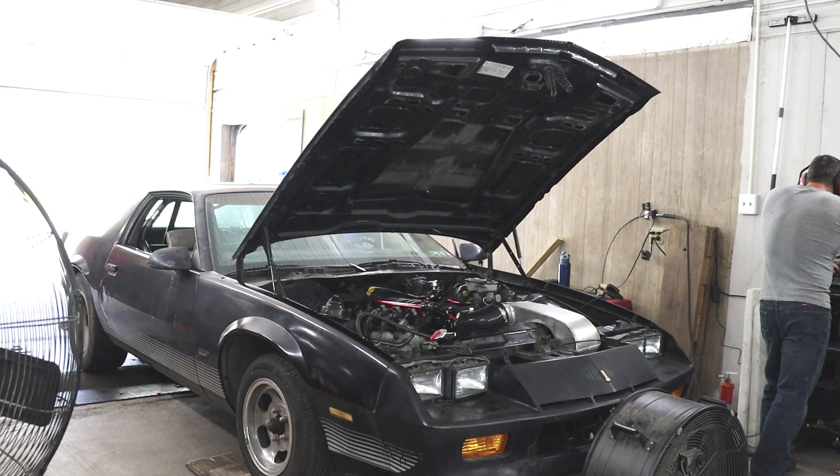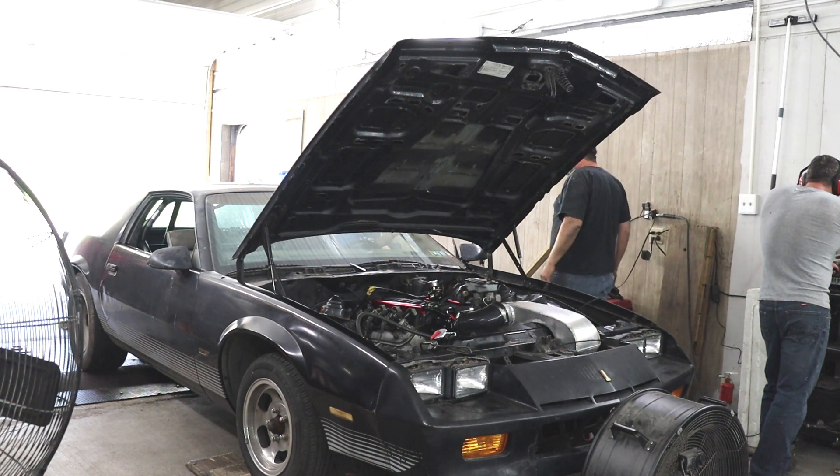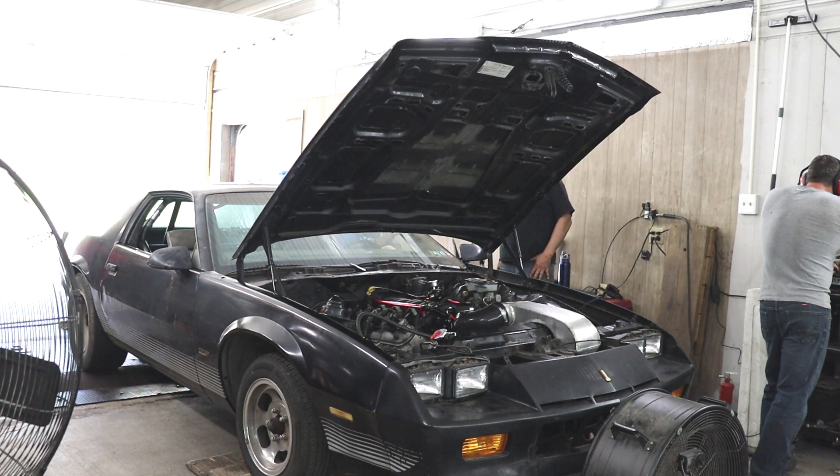As you can see, that was actually worth a little bit of horsepower. Naturally aspirated guys are probably aware that a five horsepower gain is kind of a huge deal. It's not like a boosted engine where you can just turn it up a couple pounds of boost to get to where you want to go. With a naturally aspirated engine, the atmospheric pressure is all the pressure you're going to get, so seeing a five horsepower gain — which was likely due to better distribution of the fuel — was huge.